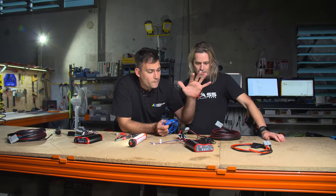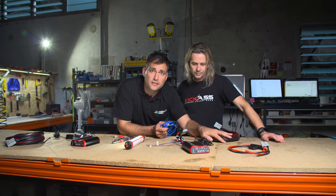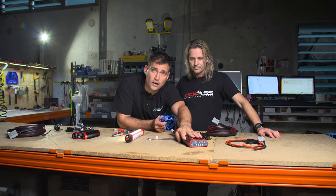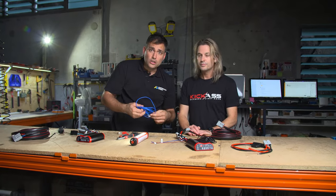On a lot of new vehicles — and I'm not going to get into the complexities now — the voltage from the start battery isn't sometimes high enough when it should be to have the DC charger running at all times. So you need the ignition wire. I suggest that all vehicles past 2000, pretty much, should use an ignition wire.